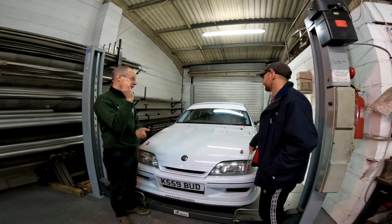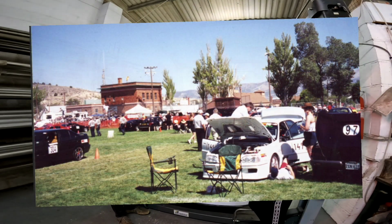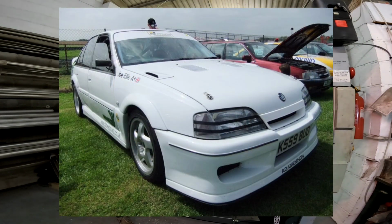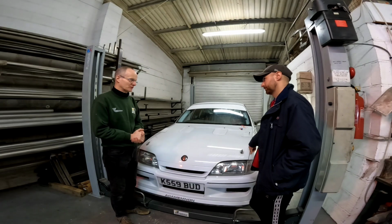And beyond that, it did go over 180. I don't know what the real speed was. It's geared so I had to do it all in fifth gear. Sixth gear is hopeless, it won't pull it. Sixth gear has a theoretical top speed of over 300 miles an hour, which is crazy. Aerodynamically, you just hit a brick wall, and the revs run out. I don't know what the rev limit's set at on this ECU, because it's a development ECU, so it's potentially a bit higher. I think we can safely claim that we were probably pushing 180.